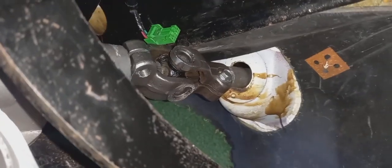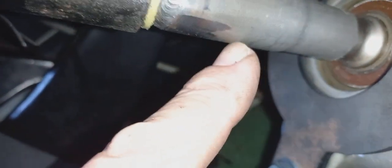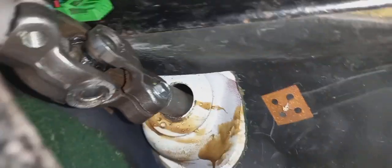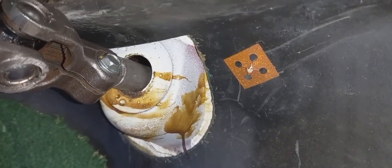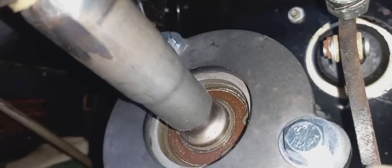The ideal gap between the end of the spline shaft that runs up to the gearbox and the spline shaft which runs down to the shaft onto the steering rack is 50 millimetres. After much cutting, I think I might have a clearance issue there, and that's because I've welded this about 20mm too far — I should have cut that. I'm going to pull the whole lot back. Everything else clears; I might have to do a bit of customisation. I'll tack weld that spline shaft into the penetration piece. The bush should fit — it's all on anyway. It's just a matter of making up a bracket to stop any rotation there.